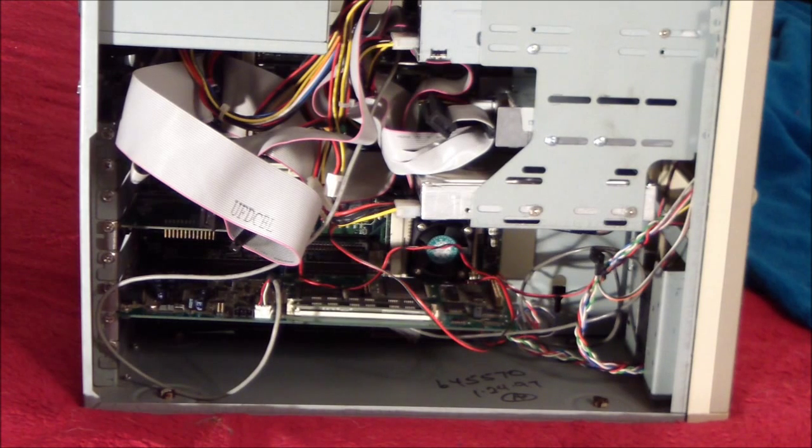Really, it has its quirks, but once you figure it out, it's actually a pretty decent, fast board. It does weird things. Like, when I had the Coast module, it would tell me at POST, it will say 256k L2 cache. Again, the cache check didn't see it. It wasn't working, even though it was being detected. It took me a while to figure it out. I had to take out the EDO RAM and replace it with FPM RAM, and then it miraculously worked. So the board has a lot of little quirks.